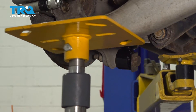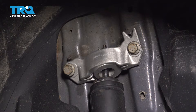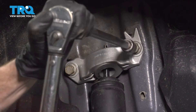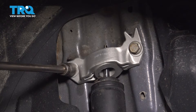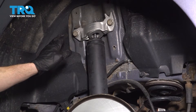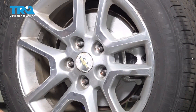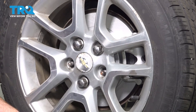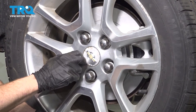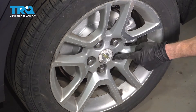Let's get this out from under here. Now it's time to snug our two 18-millimeter upper mount bolts. Once you have both of those bottomed out, torque those to 74 foot-pounds. One last thing before we put the wheel on — double-check to confirm you tightened and torqued everything as necessary. Let's get the wheel on here. Start on all five of your 22-millimeter lug nuts and bottom them out. Get the wheel safely back down on the ground, and then we'll torque each of these lug nuts to 110 foot-pounds. With the wheel back on the ground, we'll be torquing these in a crisscross manner.